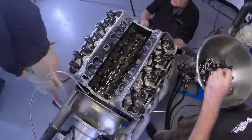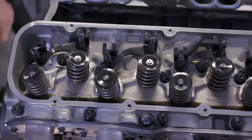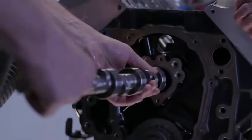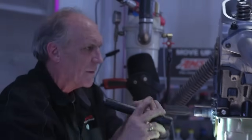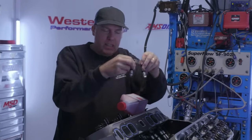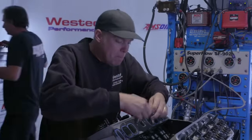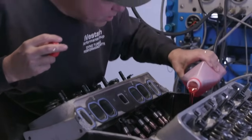To make the test as scientific as possible, we wanted to use the same valve spring on both camshafts. Brule spec'd the Comp Cams part number 933 spring. You really don't want to bang into the cam bearings — gently guide it in nice and easy. These solid lifters always have a link bar because you can't have a roller lifter rotating freely on the cam. It's really critical to look at the arrow pointing the right direction — if you put it backwards, it destroys itself immediately, if not sooner.